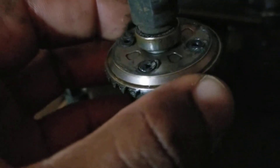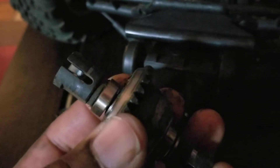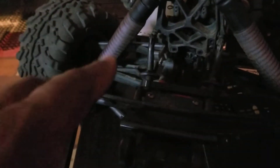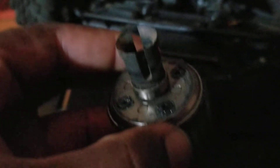This wasn't just the rear — this was the front too. Look at that — see how those screws are popping up? They're not even flush, guys. Now I really like my Savage, I really like HPI, but come on, let's do a little better than that. It's rocking front and back. If you have the new Savage GT6, I suggest before you even run it, go ahead and take these diffs out and check them, because this would have caused a catastrophic failure if one of those screws had backed out far enough.